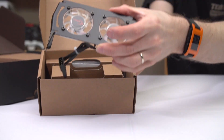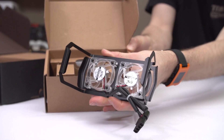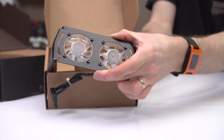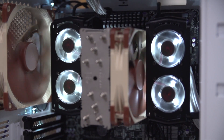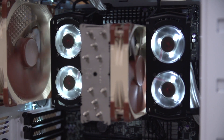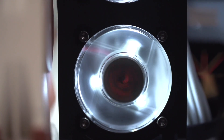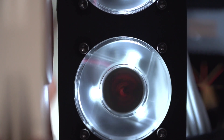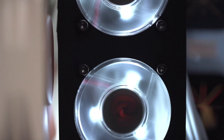In the past, I used to say that these RAM coolers were kind of stupid, and I still don't care for the added bulk of them. In our test system here, they made it impossible to install a graphics card in the top slot. But I've seen them make a difference to RAM stability, so if you're going to push these sticks to 2400 MHz or even overvolt them past the rated 1.65 volts, I would recommend installing them. One bit of constructive criticism for G.Skill: I'd like to see them terminated in three-pin connectors so I can easily hook them up to a fan controller.